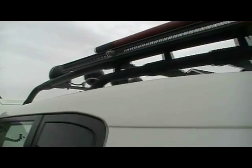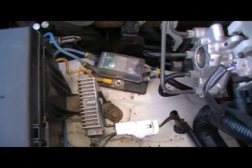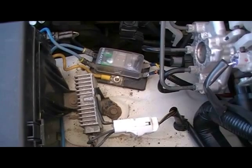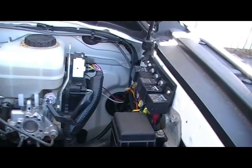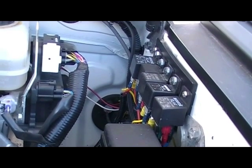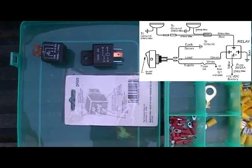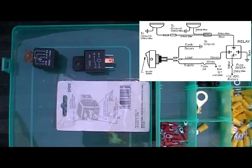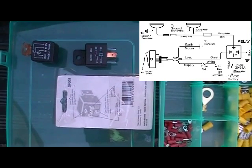All four bulbs are lit right now with power directly from the battery. The yellow wire comes from the battery to the fuse blocks, then from the fuse box to the relays. I've got relays for my bumper lights, roof lights, and backup lights. I'm using two different styles of relays - the stud positions may differ but the pin numbers mean the same thing, and I have a guide on my electrical box.